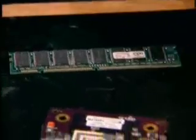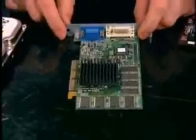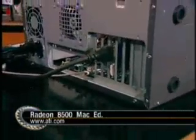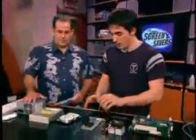Did you go with ATI or NVIDIA for graphics? I could have gone with NVIDIA, but I found a really nice ATI board with S-Video out. The board I put in my system is the Radeon 8500, which has S-Video on the back and also has the ADC connector for Apple flat panel displays. You actually have to go with a Mac-compatible video card — you can't just go out to the PC store and buy your standard ATI. Just because it plugs into a PCI slot doesn't mean it will work. You can still pick those up at CompUSA or ATI.com.